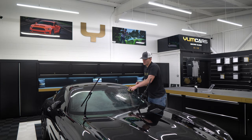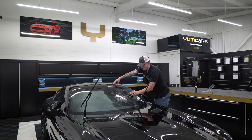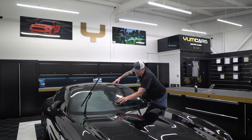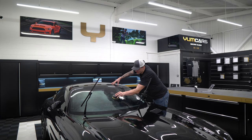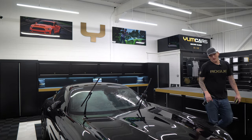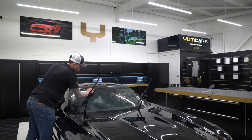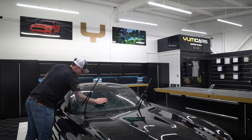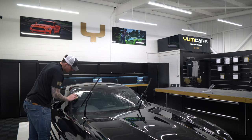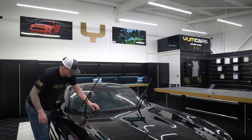I'm going to put a bit more pressure behind this than I normally would on the paint, just to expedite breaking the block in a little quicker. It's got three little grooves which help you hold the block perfectly. I can go right to the edge because the cut is really nice and you can follow the contour of the car quite well. Certain parts of this car are going to be really bad, as you've seen from the tar step — it was picking up tar. If I've missed certain bits with the tar step, the clay will pick them up.